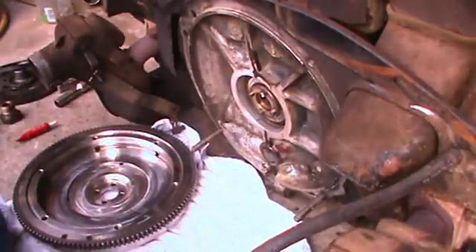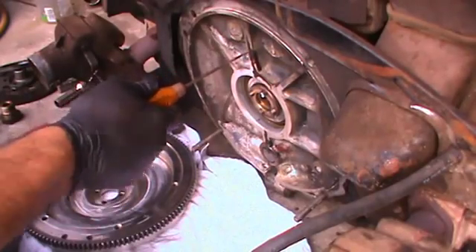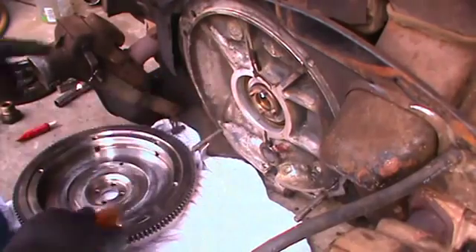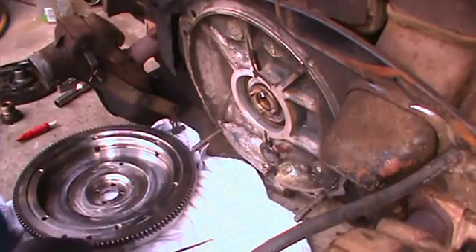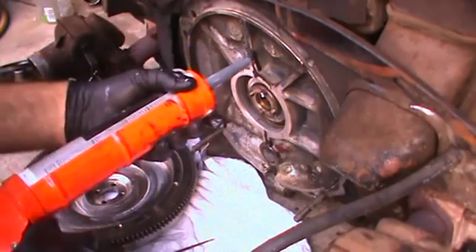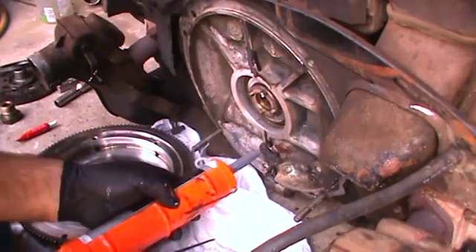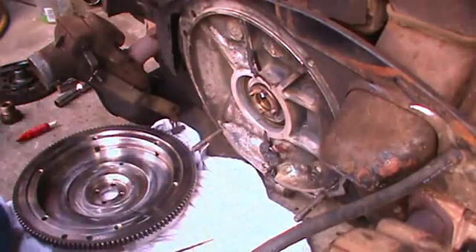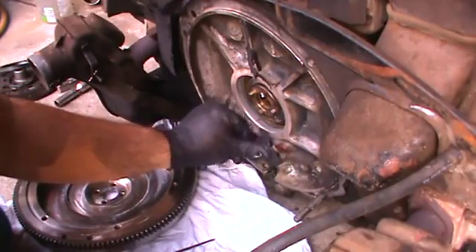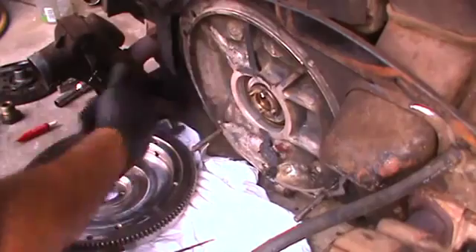So we have our O-ring in there, we have our shim pack in there. The next thing we're going to do, just for a little bit of insurance — because this motor's Aviation Permatex, this stuff gets brittle and you can see it cracking off the back of the case — we're going to wipe a little bit of silicone on the crack of the case, just to protect our new clutch disc. It's just cheap insurance. If you have all new parts and you're building a motor from scratch, this isn't a necessary step. This is for a high-mileage motor — if you're putting a seal in it you don't want to take a chance of compromising your seal. Just run a little goop around the cam plug there. You're not looking to make a bead — just put a small thin film over the crack. Just like so, clean it off, and you're done.